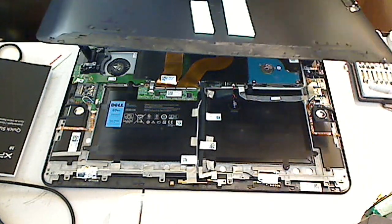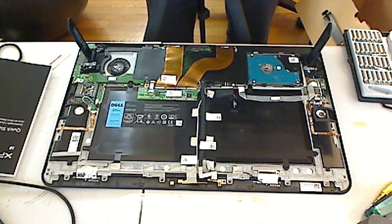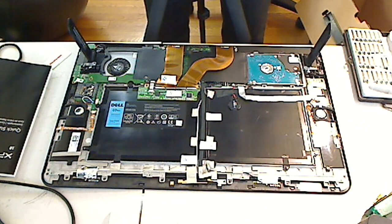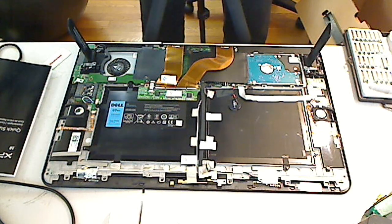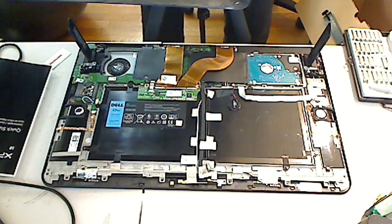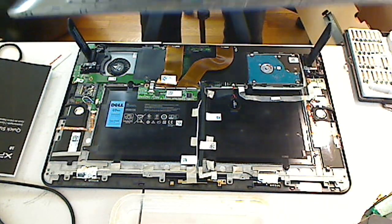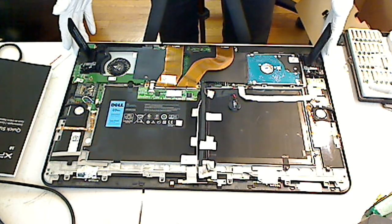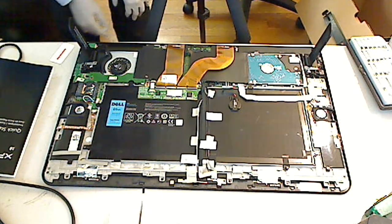Once you remove the back cover, let's see what's inside. The date here says 2013-09-18, so this was assembled and manufactured in September 2013. There's a little door here for the SD card — you don't want to break this, it looks pretty fragile. The inside of the cover looks a little bit like the unibody MacBooks. Since everything is made in Foxconn, it pretty much looks like an early model Mac — Foxconn design. I recognize the FPC connector here, which likely connects to the touch screen digitizer.